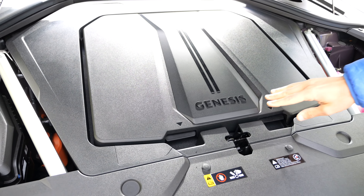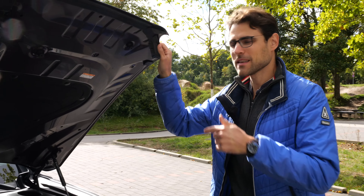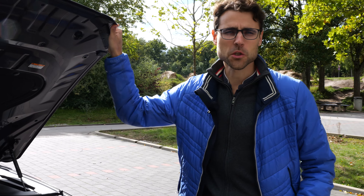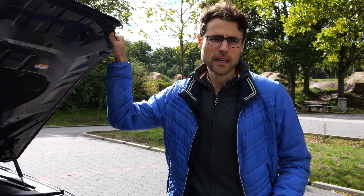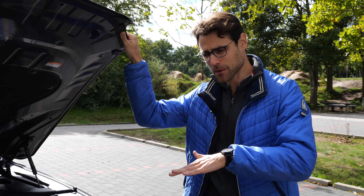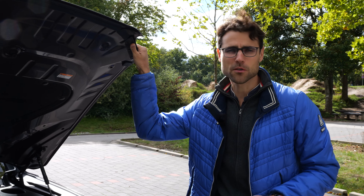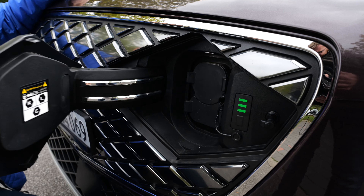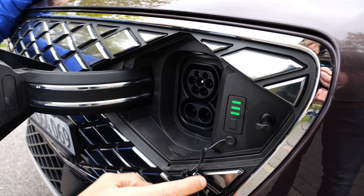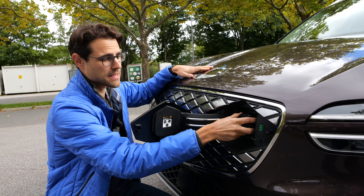Talking about the general vehicle, this is the EV version with a 77 kWh net battery. That will bring us a range of around 400 kilometers or 250 miles, maybe a little bit more. It also features a heat pump so you don't have so much range loss in winter. The general platform offers a petrol engine 2.5 liter, or in the US also a 3.5 liter V6, and a 2.2 liter diesel. The charging port is hidden in the front — that looks cool — and it has an 800-volt architecture, meaning charging from 10 to 80% state of charge in less than 20 minutes at a proper DC charging station. This is segment-leading.